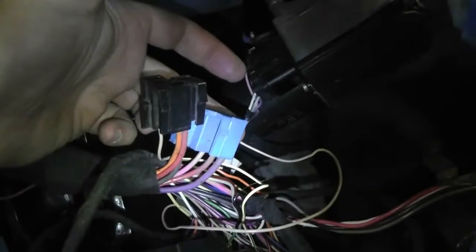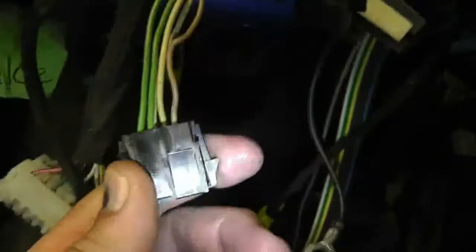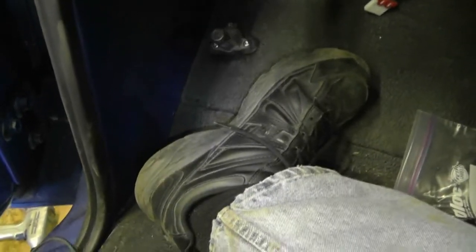I'm going to have to extend a couple of wires. These are the ignition wires — I've got to extend them so I can't wrap anything there and downstream. And I have to extend the wires from the dimmer switch, and it's got to go all the way down there — they might reach to the bottom of the fuse panel at closest. There are a couple of other electrical things I've got to do, like the e-brake has a sensor. That van had a sensor that would tell you that the brake was on. I'm going to just add a micro switch here, and I'll let it just ground out that line — it'll tell you if the brake is on.